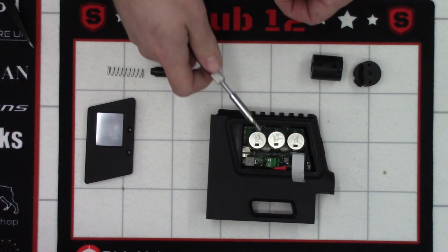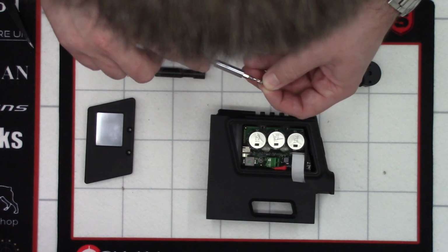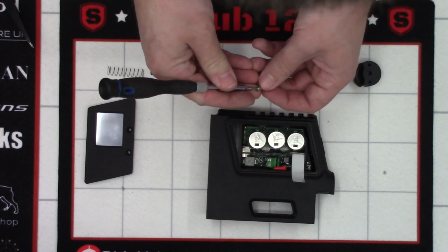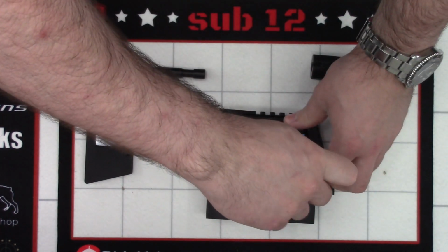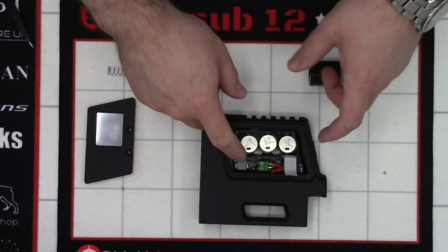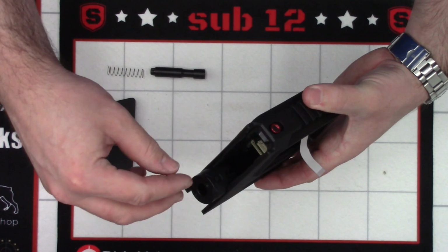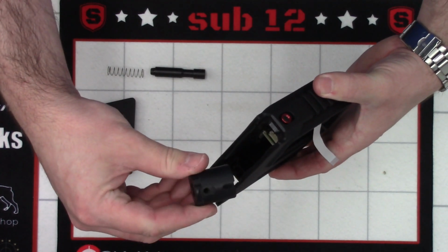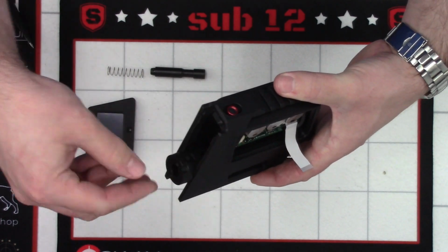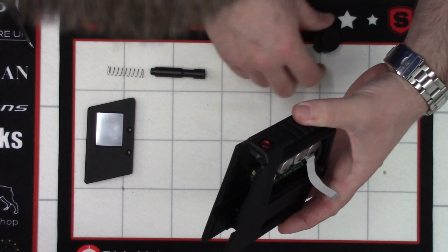Now before we do them up tight, we're just going to get both screws started. And that's using a T4 Torx bit. Once the screws are tight, what we're going to do next is just reinstall all the backing pieces for the coil. So first is this plastic piece here, and this slot goes downwards. Get that lined up, push that in, make sure it's seated home.